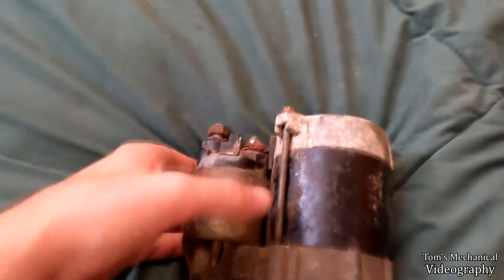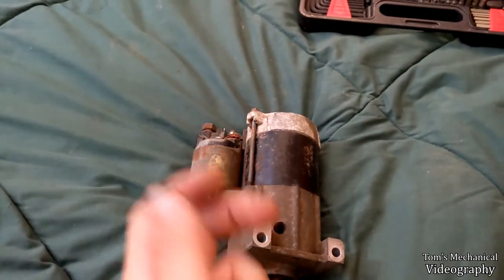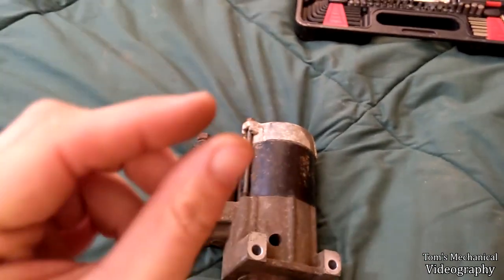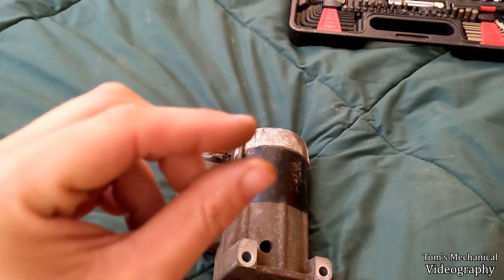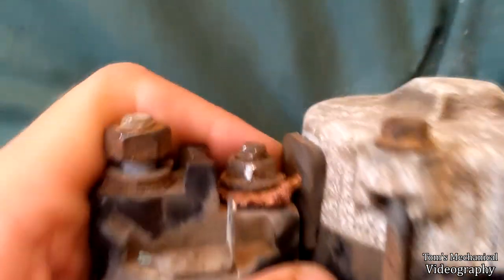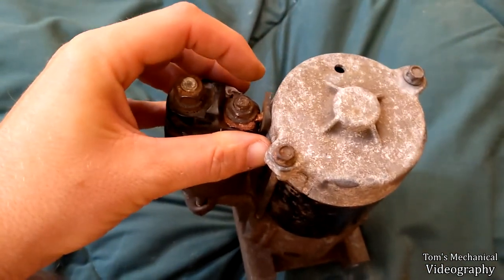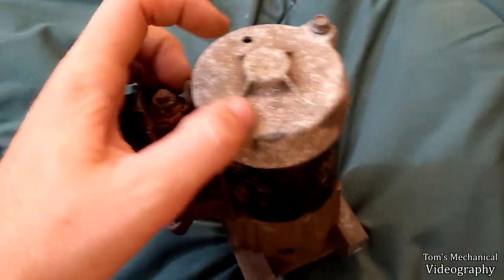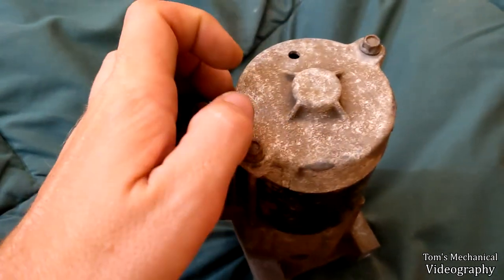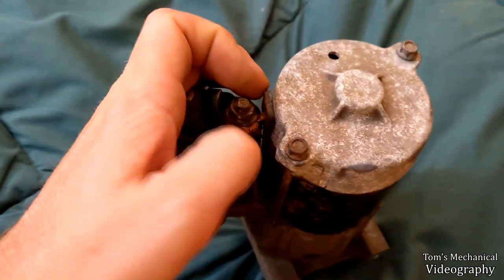Mostly. Alright, so I pulled that wire out, I got my knife, and I was able to peel back the weave enough to get just a little bit of a fork, maybe about 3/16 of an inch on the end of it, and I just ran that fork on either side of this bolt, and then I took the eyelet. The eyelet for this thing was actually not steel, it was woven. It was this big old chunk of woven copper, like woven into a rope, and then they just pushed an awl through it and made a hole in the wire itself.